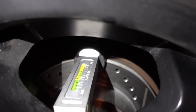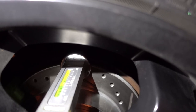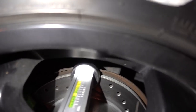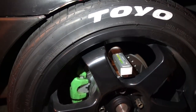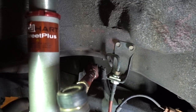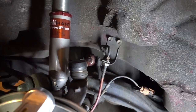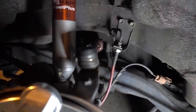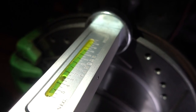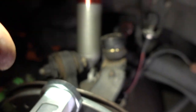I'm gonna remove the tire, and I know that by raising up the car the level is gonna change, so I'm gonna keep the level set where it is. I'm gonna loosen the camber bolts and then just move it half a degree and the rear setup will be ready. Once I finish this rear one I'll go to the other side, and once that's done I'll move to the front. Right here I need to loosen the nut on the back — I have a 24 millimeter wrench. Right now the bubble sits on negative three degrees of camber, so I'm just gonna go half a degree.